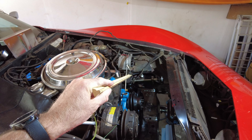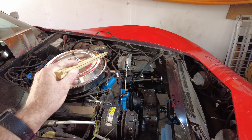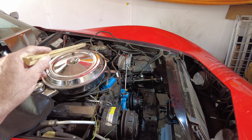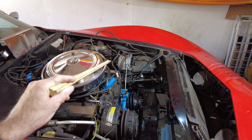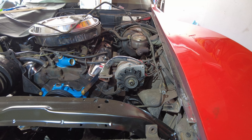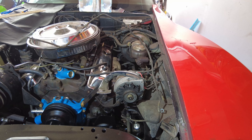I'm going to take this line off. There's another shorter line, about a foot and a half, that comes from the proportioning valve back to the left front brake. The front proportioning valve is located on the left side under the fender, kind of under the brake booster as well. I need to get the other end off and another short one off, and hopefully it'll go well. Looking head-on onto the Corvette, there's the master cylinder and underneath that is the front proportioning valve, which I'll show you now.